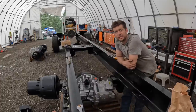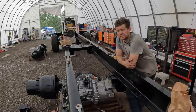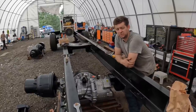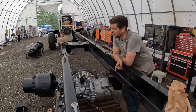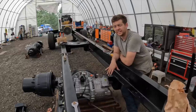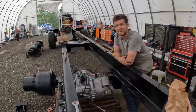With both motors facing inward, your wires don't have to travel as much. With a walking beam suspension it moves, and the closer you are to the center of that moving beam the less it travels - so the less our high voltage and coolant lines have to travel. There's going to be one cross member rail right here, two torsion arms, run the lines up the side where the torsion arm goes. It's actually a smart way to do it. Basically one motor's going to be running full speed in reverse and the other in forward. The cool thing about electric motors is they go just as fast in reverse as forward - so technically this truck can do 140 in reverse!